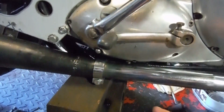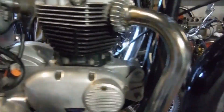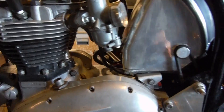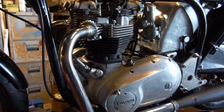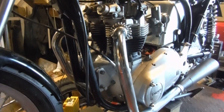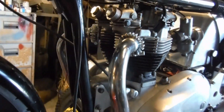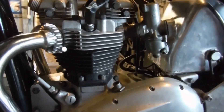We've got oil in the tank. I've also added clips to the oil pipes where they meet the engine's pipes, so that's all secure and sorted. Basically what we need to do next — we've got some electric starting rollers, and with this thing being a little bit stiff, what we're probably going to do is take the plugs out, run it in gear on the starting rollers to get some oil circulating. I've already established that we've got a good feed coming from the pump and it's actually scavenging from the oil that I poured into the crankcase via the rocker boxes, so I know the lubrication side of everything is going to be all right.